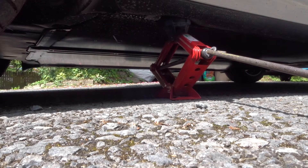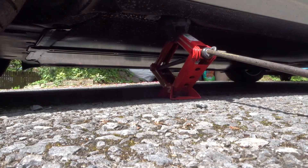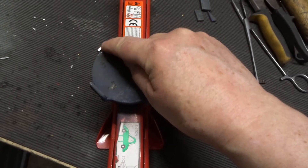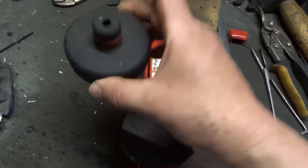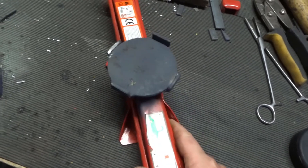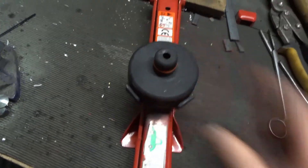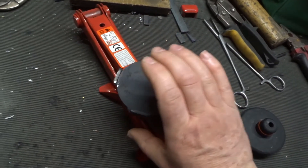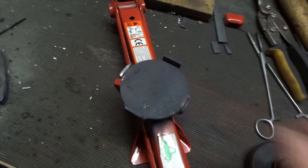I think I will use this for emergencies. Having done my little experiment, I've cut this tang down so it's about one millimeter high, which means I can put the puck up into the hole and then slide this in under the car onto the puck - which gives you the absolute minimum possible ground clearance, because there isn't much space under the car, especially if it has a flat tyre.